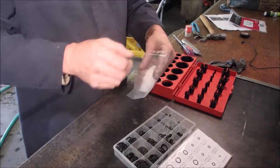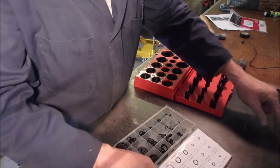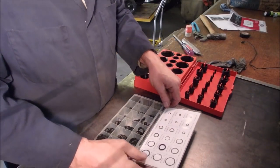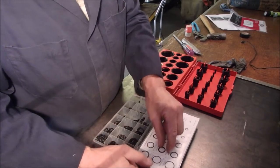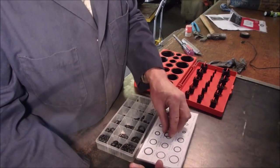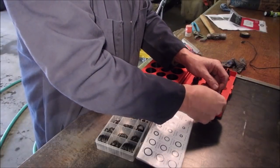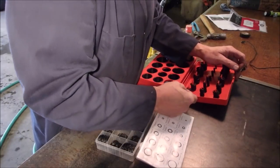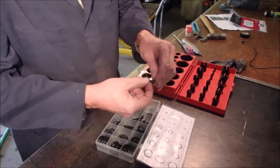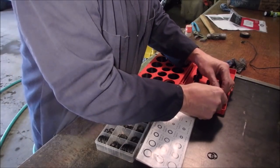I've got my two little O-rings that are the replacement O-rings that came with the unloader. And the closest one is a SAE standard 5/8 by 3/4, which is this one. And the other one almost looks like it's going to be lined up on the metric side, as a R06. But they're not quite right, eh? So, that's life.